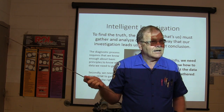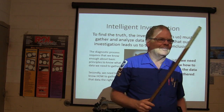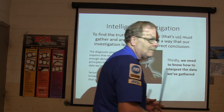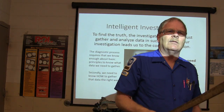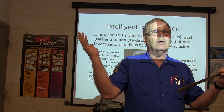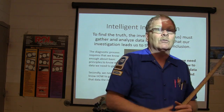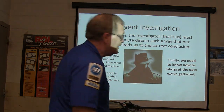I don't know if they just weren't paying attention or whatever, but the first time you hit the brake it goes scrub — the lining is facing the wrong way and the metal back is toward the rotor. I've actually seen that happen here two times, and the people that did it were pretty doggone good at their work. They just didn't have a clue. It'll go on there backwards just beautifully and destroy a rotor faster than you can imagine.